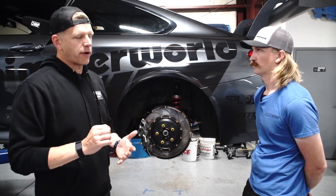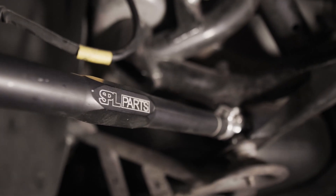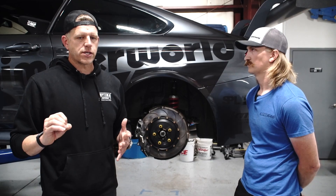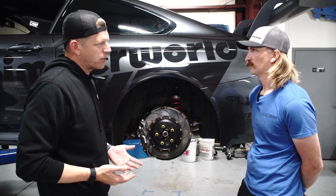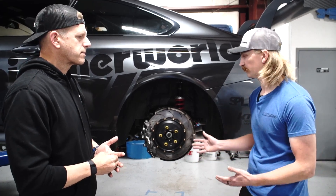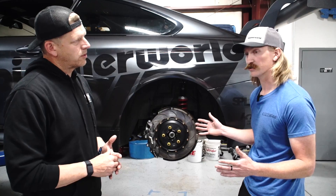We did race arms. When I say race arms, I'm talking about spherical bearing ended arms with a range of adjustment. The cool part — and this is the same kind of stuff we have on the GT4 car — is we get to set the geometry better for the track environment than the street car's range of adjustment would allow. We preset these so you get the kind of geometry we're doing on the GT4 car — making the car turn better and more stable. A lot of times your camber adjustment is done with an eccentric bolt at the bottom, moving the bottom in and out. Now camber adjustment can be moved to the top with an adjustable arm, and you can also play with tire clearance and track width — about eight millimeters of adjustment you can shift in and out on each side.